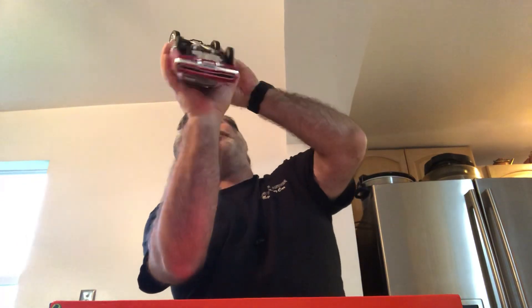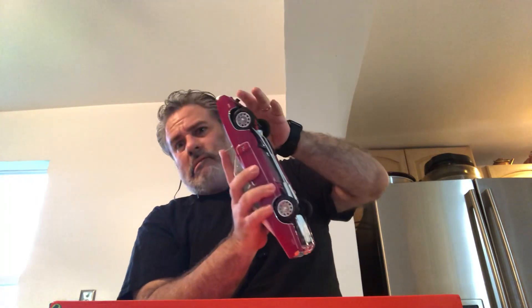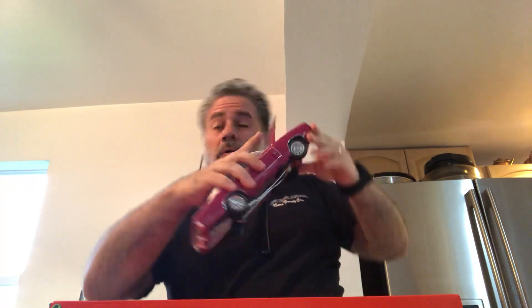It's got the four-speed, so it's got to have the Dana 60 if it's got a 440 or 426 Hemi. Let's see what we can do with the hood — oh, there we go. It's a 440 6-pack car. They didn't have any designations for 440 6-packs on these cars. On a Challenger it said '440 6-pack' on the hood, but this one for whatever reason didn't have any designation anywhere. The air cleaner on this one is a lot better than the one on the Bullitt Charger.